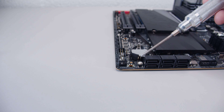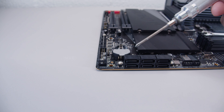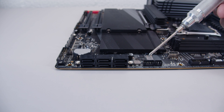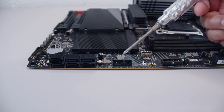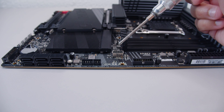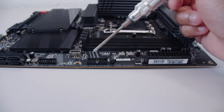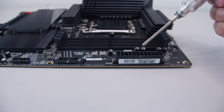There's also a surface-mounted reset button. Six SATA ports for your 2.5-inch SSDs and spinning drives. There's a bunch of Thunderbolt headers in case you've got a Thunderbolt add-in card. There's also a post-code LED array to diagnose your system, a USB Type-C front panel header, a USB 3.2 front panel header, and then a 24-pin power connector to power up this motherboard — everyone needs a 24-pin power connector.